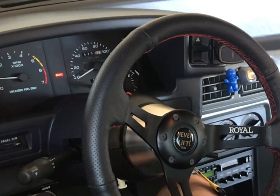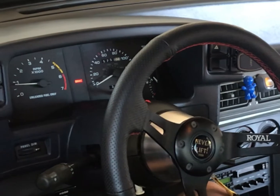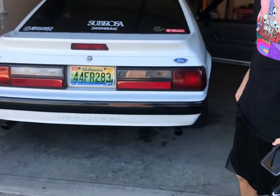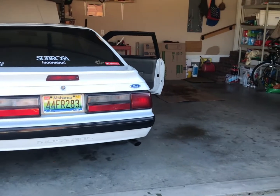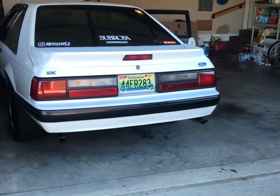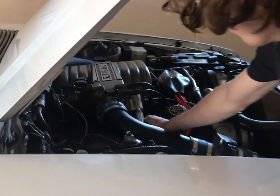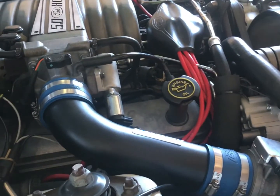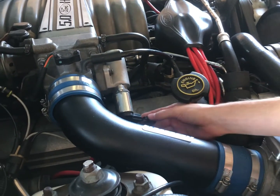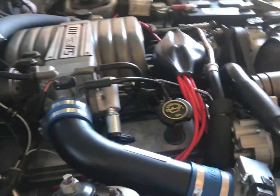Before that would have killed it. That sounds a lot healthier — I think that's what fixed sounds like. Before when we would unplug it, the idle would stay completely the same. Now you can hear that idle drop. See how it runs and comes right back? There must be something to replacing those capacitors.